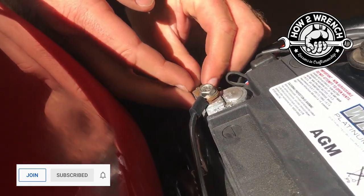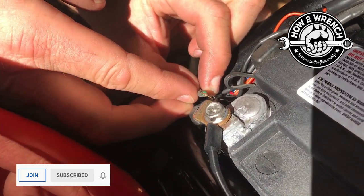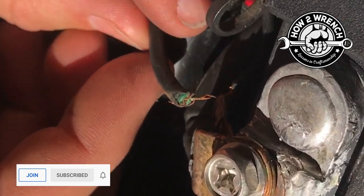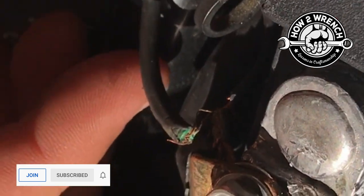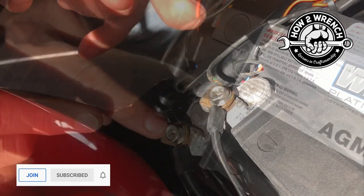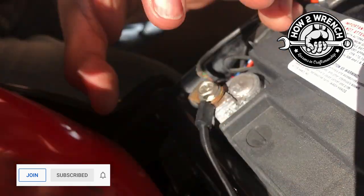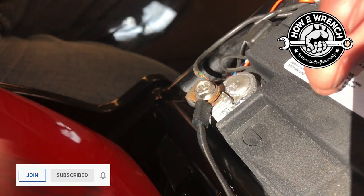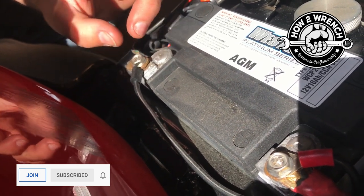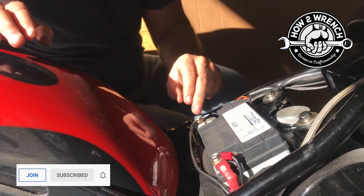Check this out — I can actually move this cable, so it's loose. Oh, I have a wire — look at that! I wonder what that little bugger goes to. I didn't even notice that at first. That sucks, that needs to be fixed. It's literally one strand — can you see that? There's one strand. I'm going to get a temp gun because when I crank this over, you're actually going to see the smoke, because it's trying so hard to push the amperage. This battery has probably around 300 cold cranking amps pushing through these tiny fittings, especially on that one strand — it's going to smoke.